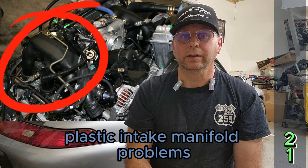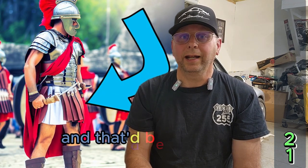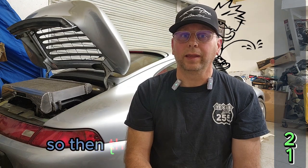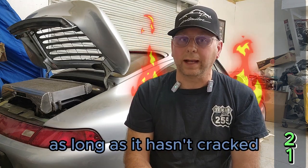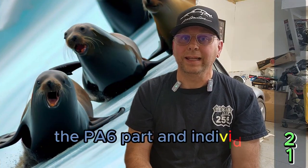Plastic intake manifold problems. We've seen quite a few of these now, with the plastic intake manifold plenum pinched where the lower hose clamps are placed on the block-off for the lower resonance tube. The plastic is getting deformed by the flap part of the clamp, and when it leaks and is tightened, it's taking that flap and folding it inward to a pinch — so the more you tighten it, the deeper the pinch gets and the more it leaks. This can be gently heated and reformed as long as it hasn't cracked. Cracked ones must be replaced, since these are PA6 GF30 material, which doesn't respond well to any glues, not even epoxy — nothing sticks to nylon. The individual runners aren't that costly and are relatively simple to replace, even with the engine in.